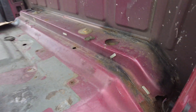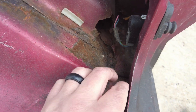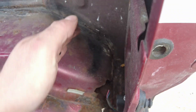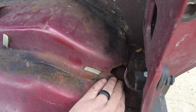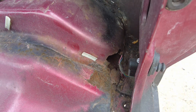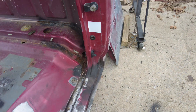As far as the additional rust I found — I knew the area in the back corner was suspicious, and it turns out it's very flaky. I'm gonna have to do some cutting, probably cut around here, get a big heavy gauge piece of steel, weld it in, and patch up the floor underneath. I might even be able to get underneath the truck itself and do some work from under. Still a work in progress — I gotta wrap my head around it and see what I can do.